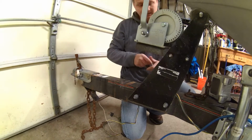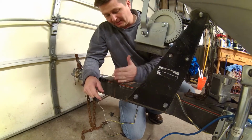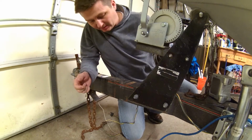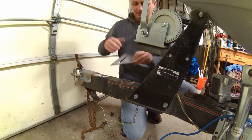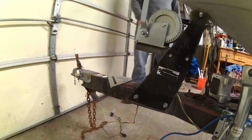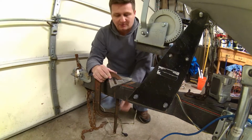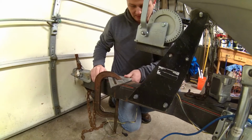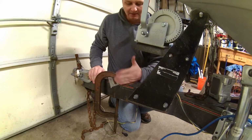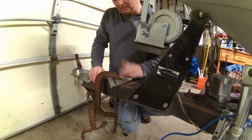Alright, I am going to use, like I said, a reciprocating saw. I will probably cut and then cut and then cut and cut. I'll do each side as opposed to just one chop. I want to get the lines as straight as I can. I'll probably even use that as a guide to help. This is a trick an old timer taught me. You can clamp your square down and rest the blade up there and actually make a cut pretty square, as long as you don't cut that up.